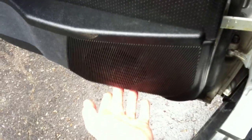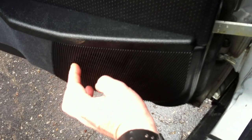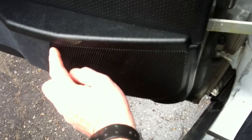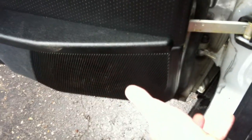Anyway, I'll do another quickie on the... Actually, I don't even think I need to really do it. On these side Bose speakers, the one screw underneath, there's a little Phillips screw, and then rotate the cover. The speaker grill goes down at back and then off. The back slides down after you take the screw out and pull it off.